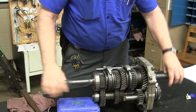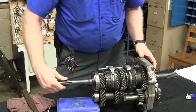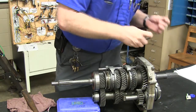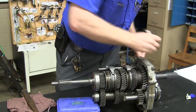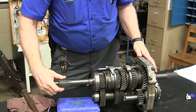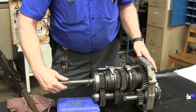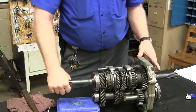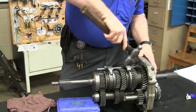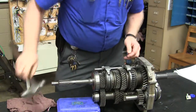Going back in neutral again. Now whenever we move this thing into third — let's see what that one is. I'm going to put a mark on there so we know where it's at. We're going to turn this all the way through. That is going one and a half to one — one and a half rounds here, that's third. And then finally we're going to turn this — fourth. Now these are all together. Everything's turning like it's all one shaft.